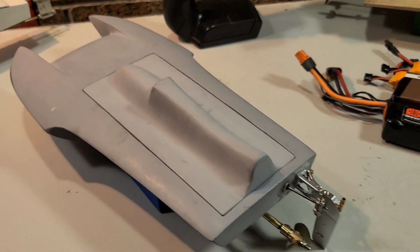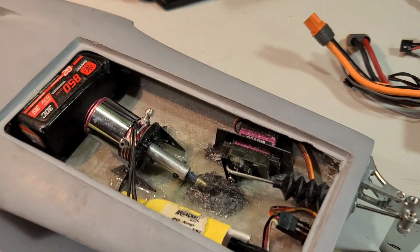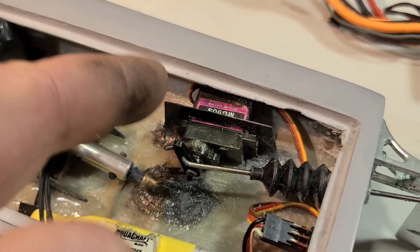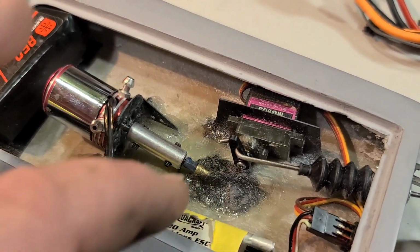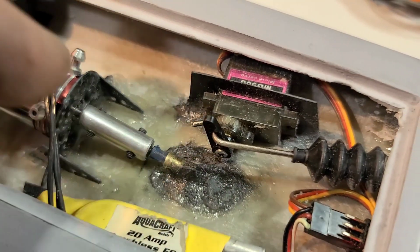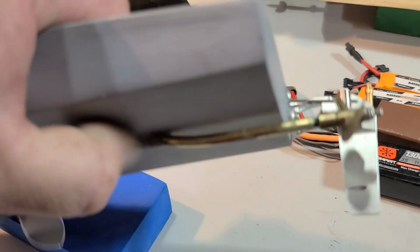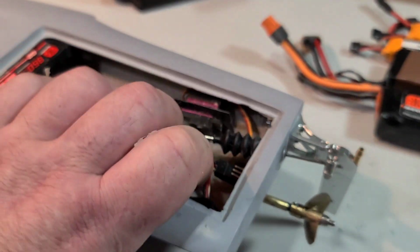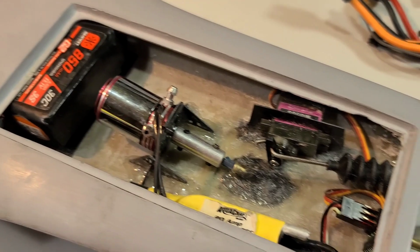Okay, it's a lightweight boat. We'll get a weight here in just a few. I got a scale. Okay, I'm gonna open it up. As you guys seen, I actually used some carbon fiber to mount up my stuffing tube and my servo mount. Some carbon fiber hairs mixed in with my epoxy. I used them on my stuffing tube to kind of brace up the through hole right here, because I will be tuning, adding or taking away bend out my stuffing tube, so that's going to kind of add some integrity to the hull so we don't crack it while we're tuning the boat.